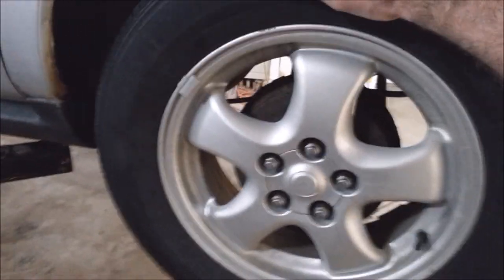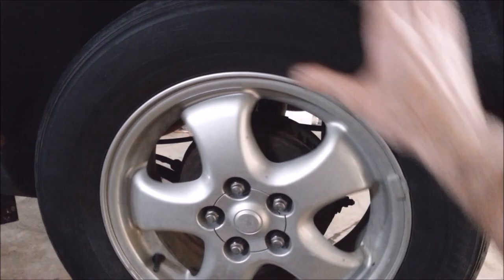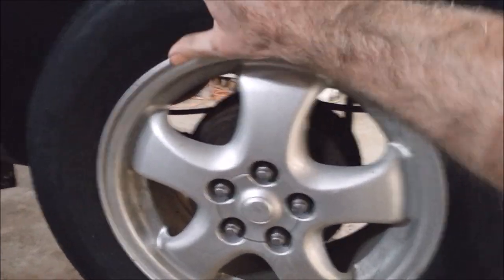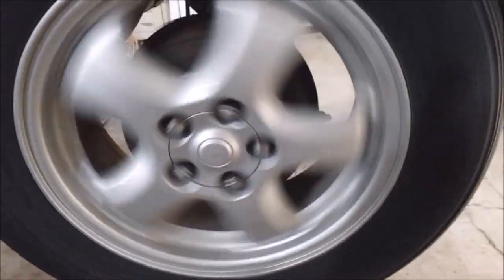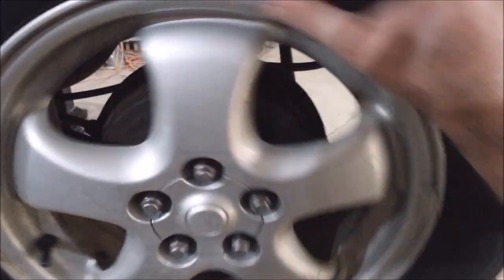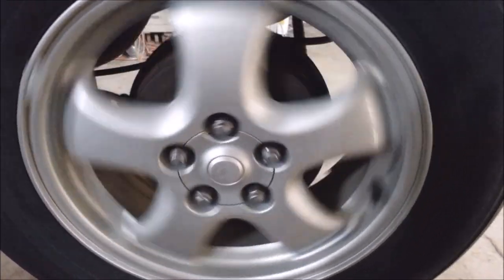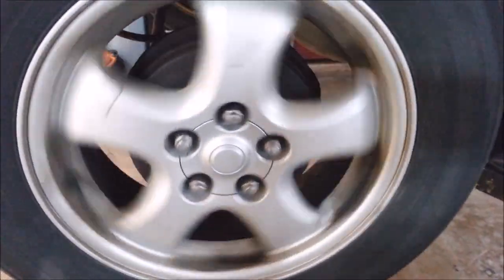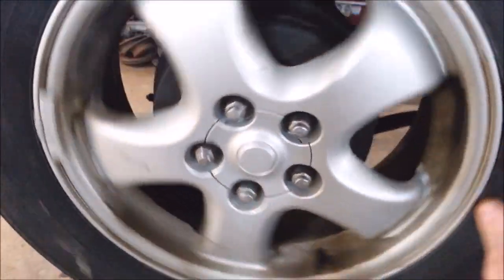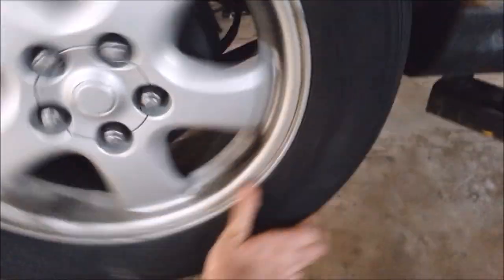You want to double check your work when you bolt the tire on. To get a good brake adjustment, the drum should just barely touch off once in a while when you spin the tire — should be like that. That's a good brake adjustment. You don't want it any tighter than that — it's better to have them too loose than too tight. See, it just barely touches in like one or two spots. Now I'm going to go test drive this car.